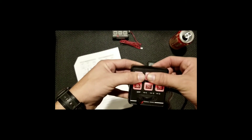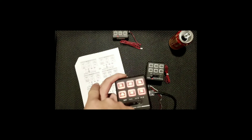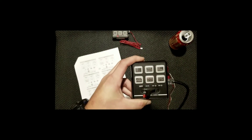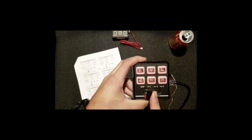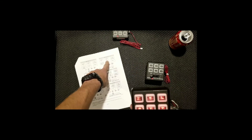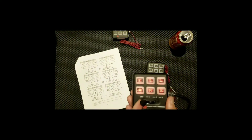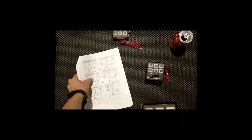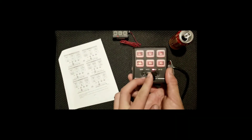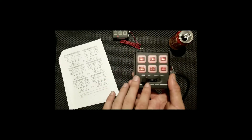Now let's say you liked keypad number 2.1 — how do you get that? Easy. Press the top three buttons at the same time. All of them will flash. When you want keypad 2.1, take your slide switch, slide it over to position one, press button two, and that activates keypad 2.1. In this case the center button is mode two, so if I push that there go my lights. I can also use the slide switch for left, center, and right traffic advisor.